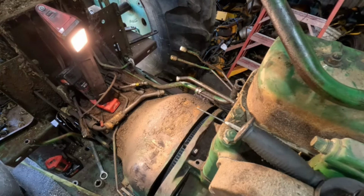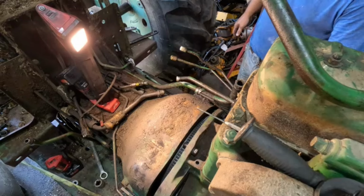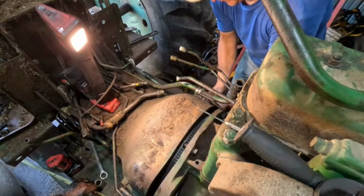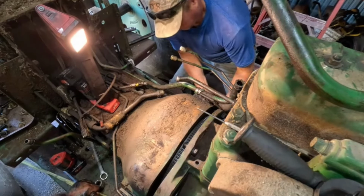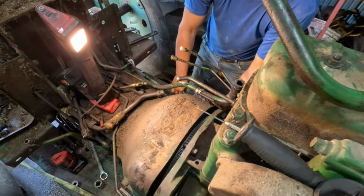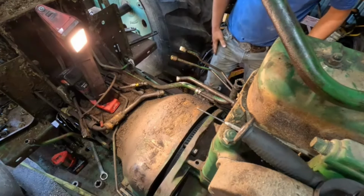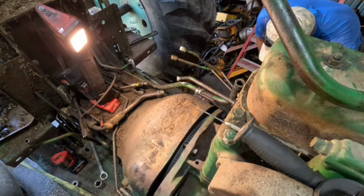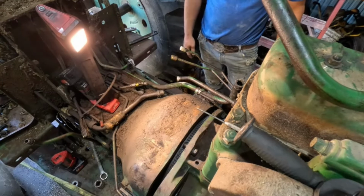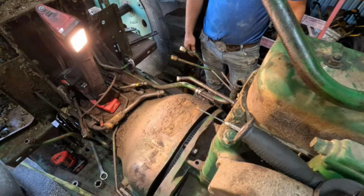I think the front end's got to come up a little bit, because my dowel's on an angle over here. Okay, let's try it now. I'll turn the flywheel. Should hear kind of a little pop. Just a little one, you know what I mean? Yeah, it acts like it needs to come up. My dowel's sitting, okay, so I got about 15/16ths there. Underneath, I got less.